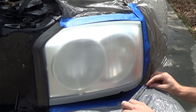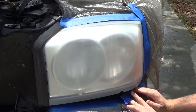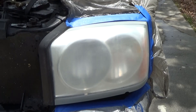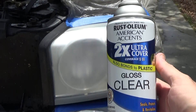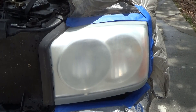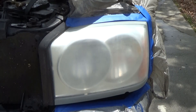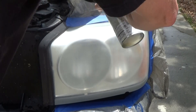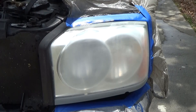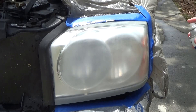On my vehicle, I opened the hood, so any overspray on the left just goes into the engine compartment, which I'm not worried about. Now that we've got it taped off, you're going to need to pick up a can of Rust-Oleum or Krylon — they make a very similar product. It should be clear gloss and make sure it says it bonds to plastic. I really like the Rust-Oleum because it actually says it's UV and fade resistant. I have no idea how long this is going to last, but I suspect it would easily last a year or more.